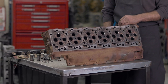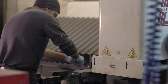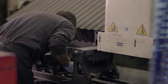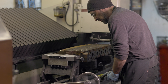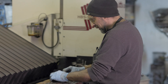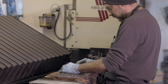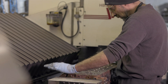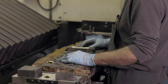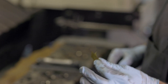Ready for the resurfacer. Now we've got it in here in this resurfacer, so now we've got to level it. The level's telling me this end is high about five thousandths of an inch, so we'll just use brass shim stock.